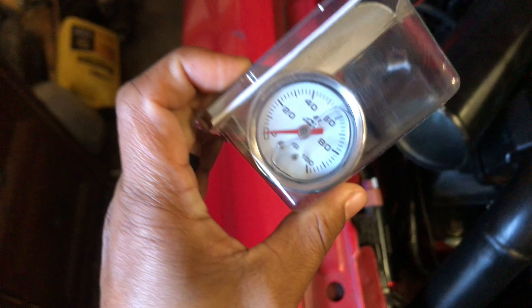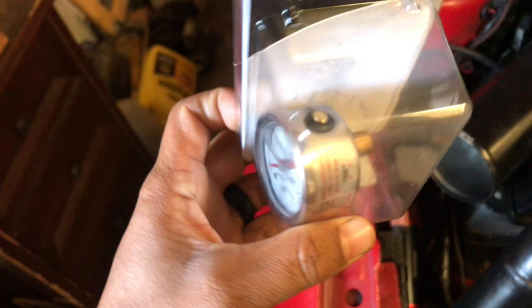I'm going to be putting on this new fuel pressure gauge — this Aeromotive one specifically allows you to pop open a little pin to equalize the pressure so we always know the fuel pressure is right. I'm also putting in a new cluster, and I'm going to add a secondary relay because I'm going to make a dual fuel pump setup, so I'm going to cut out the whole factory setup.